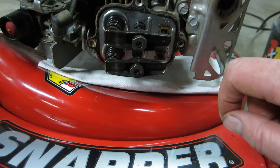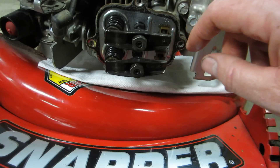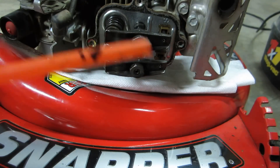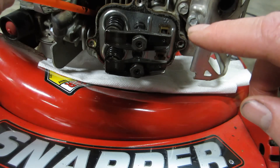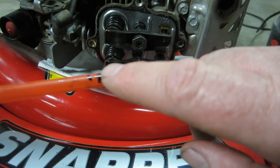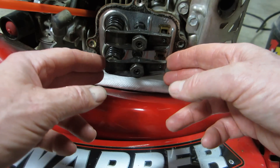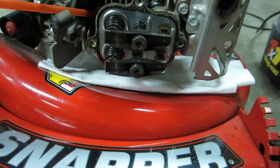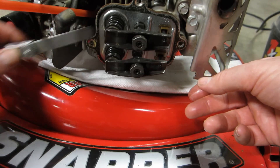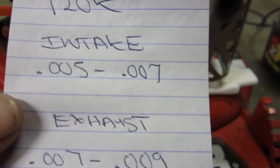What I'm gonna do now is check what the measurements are for the intake and the exhaust. How you do that is you find top dead center - use your favorite drinking straw, mark it, and put that in the hole. I've got top dead center now, then crank it down a quarter of an inch. This is your adjustment position. I can look at these and tell they are way off. I've got this set up as a 0.014 feeler gauge and it's going in each one - that definitely would make a problem starting.